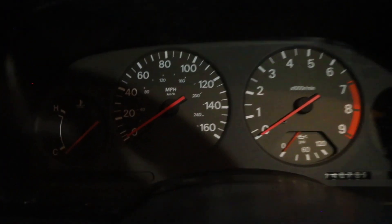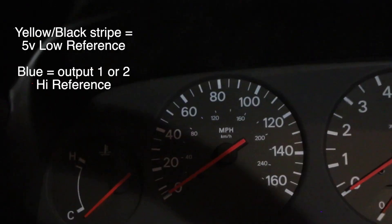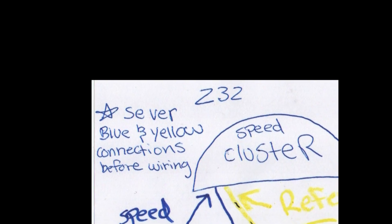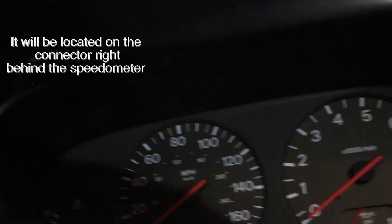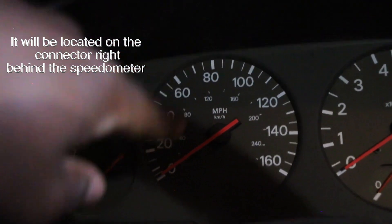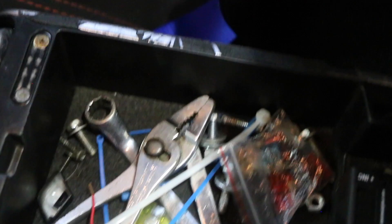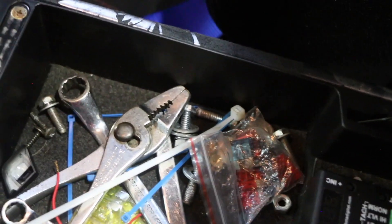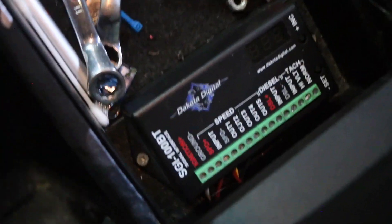Your speed negative — this is where things get interesting. Your speedometer for the Z32 is going to have two wires: a yellow and black wire and a blue wire. Both of those wires — the yellow and black one, you're going to snip it, and the blue one, you're going to snip it. Make sure you give yourself some length for the wires going back to the speed sensor, because you're going to be rewiring them directly to this module. You're going to extend the yellow and black wire and route it all the way back to the speed negative. Then go into your transmission, grab the negative connection off the speed sensor, and wire it directly into the same speed negative input.